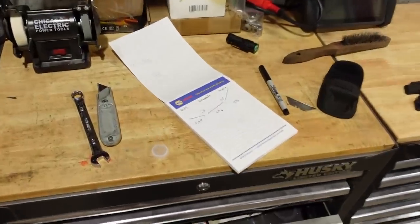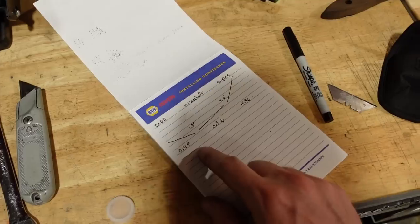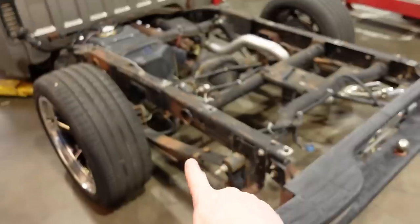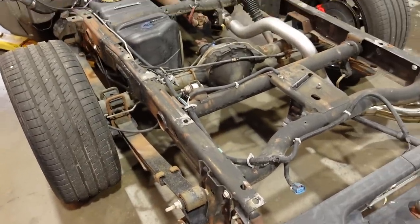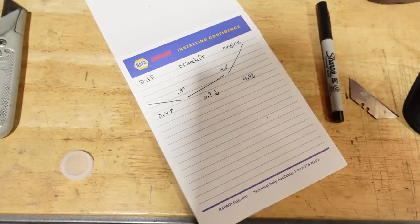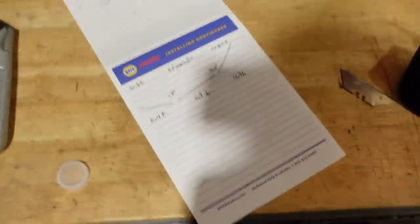One last thing worth mentioning, I took a bunch of measurements of the driveline angles, engine, drive shaft, and differential, just to make sure that we get this thing nailed, because of course the spring perches on the bottom of the axle for the flip kit, of course they're not welded on, because why would you do it the right way? But good thing they're not welded, because the angles are incorrect. This diff needs to be pointed uphill a little bit more, because you have this kind of horseshoe shaped angle where it needs to be